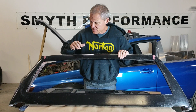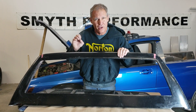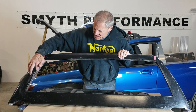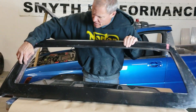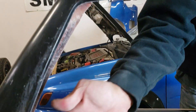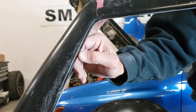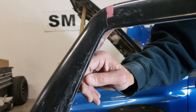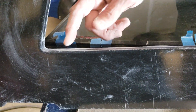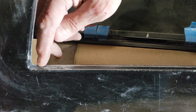So the trick is — and this is one of the messier jobs in the kit — if you can do this you can pretty much do everything else with ease. The piece comes rough trimmed, but this edge — come on in and take a zoom here — this edge right here, you see where I described a line, as it's rough trimmed, this whole little edge here is about 3/8 of an inch. A half an inch would be too much, a quarter is too little. This is about 3/8 of an inch thick. So from the top edge here to this edge here, I just take a razor blade and I scribe a line.